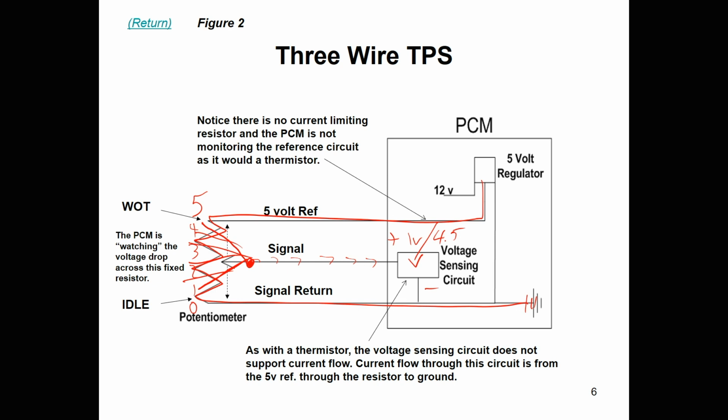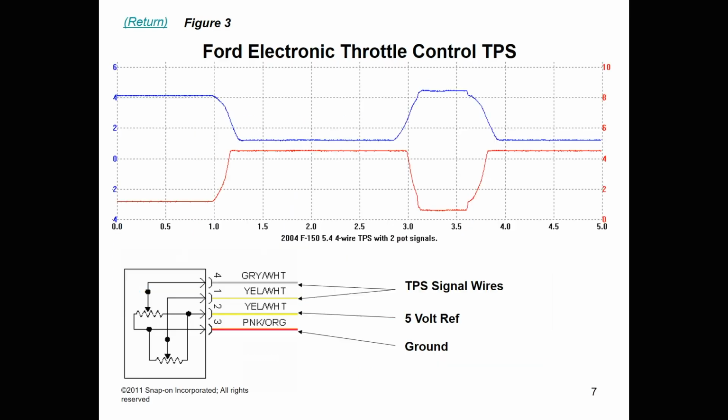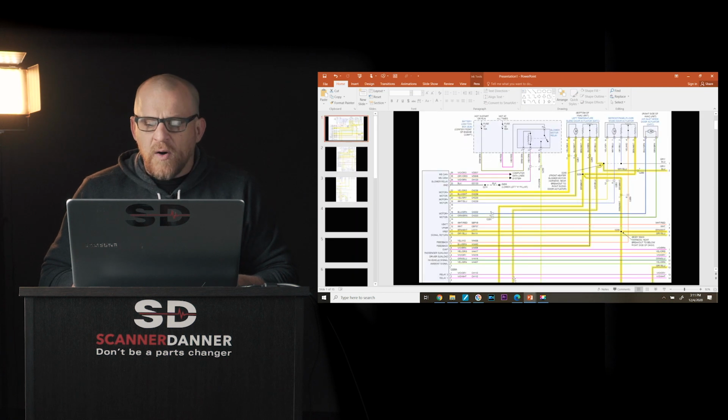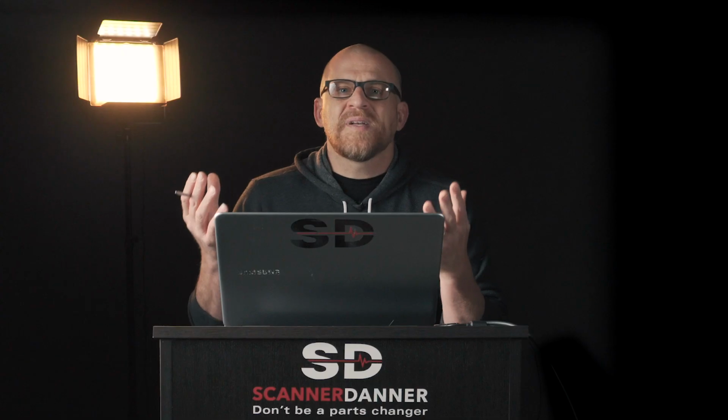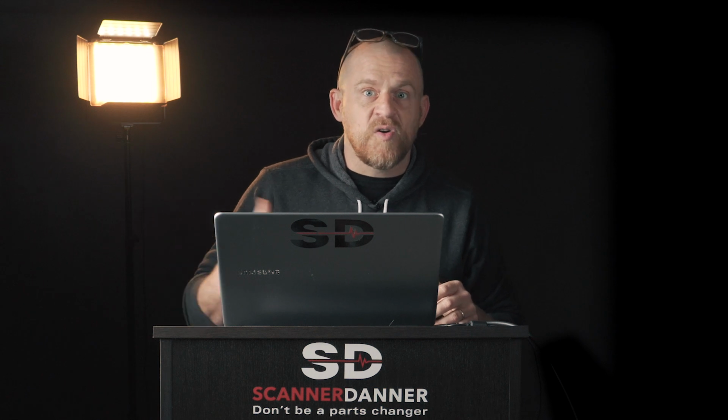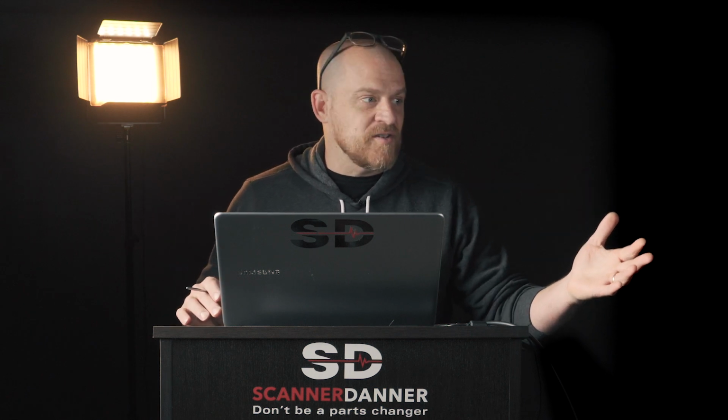That's why potentiometer circuits, when you look at them, they're nice and smooth as the wiper moves up and down. That's what you're looking at in these. There's a drive-by wire on a Ford, 2 potentiometers, increasing and decreasing signal. That's what you want to see, okay? Standard stuff here, guys. That's how we know. We learn our fundamentals. We come to a car that is now using a potentiometer as a climate control temperature blend door. But it's the same checks that we've learned how to do on a throttle position sensor in 1985 on a Dodge Aries.